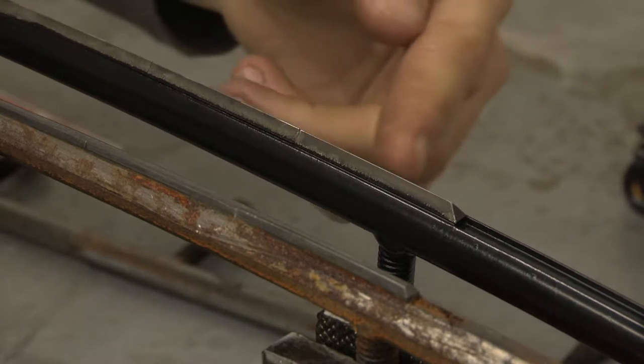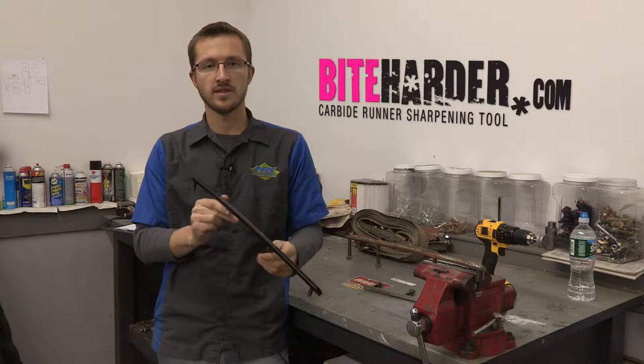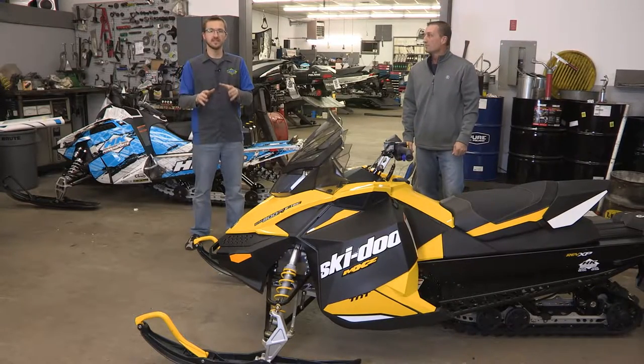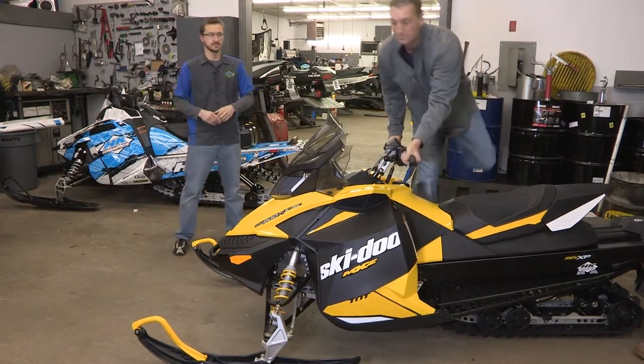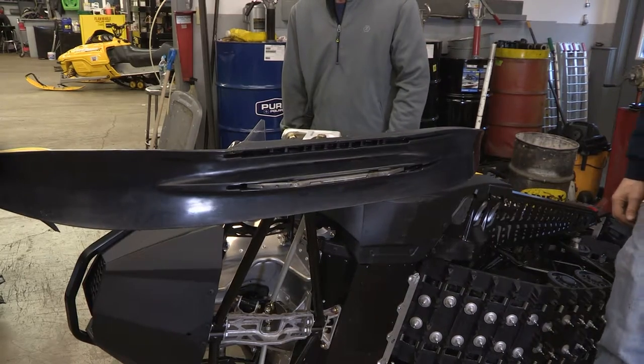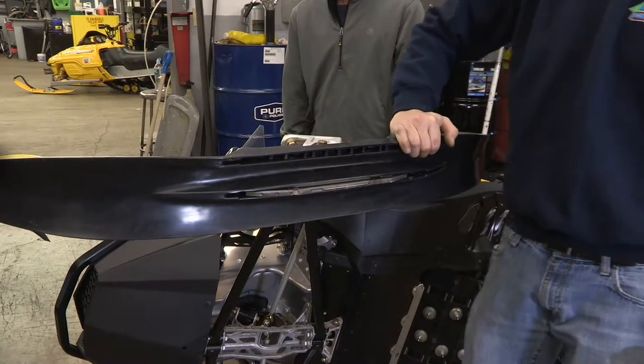Using the Bite Harder sharpening tool, you'll be able to sharpen the edge of your carbide so it works like new again. And it's extremely easy to use. The first step is to get the snowmobile up on its side. The next step is to stabilize the ski by holding your body against it.